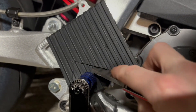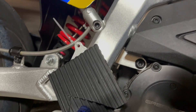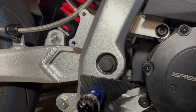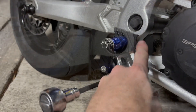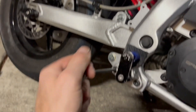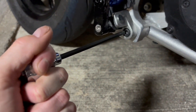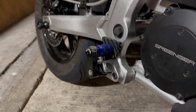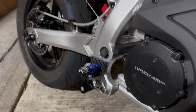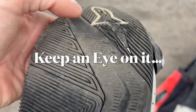Here's where I've taken a razor knife and cut out my rubber block. I'll cut it here on the front to finish it up. I cut the front off the rubber pad and then I'm just going to tighten the foot peg back up. And that is my Ghetto 2.0 foot peg mod. I'm going to go ride this at the track tomorrow. I may do something later on with the pegs, but that gets me my shorter foot pegs and more ground clearance on the electric bike.